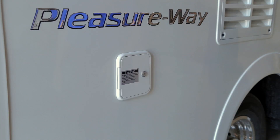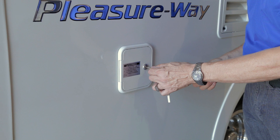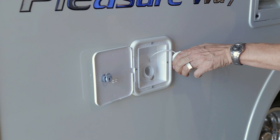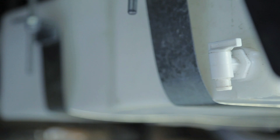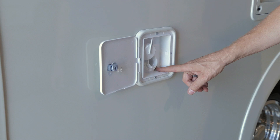To fill your onboard water tank, open your potable water storage door at the back on the passenger side using your 751 key. Remove the white cap, insert your garden hose into the opening, and allow the tank to fill. If you notice water dripping underneath the vehicle, ensure your drain for the water tank is closed. Once the tank is full, you will see moisture coming out of the vent line and fill spigot.